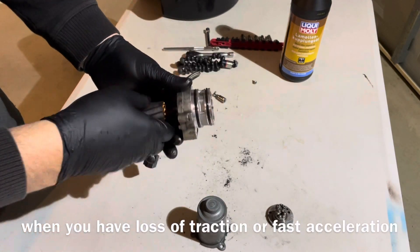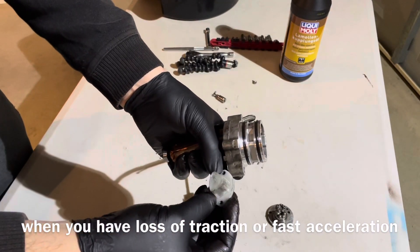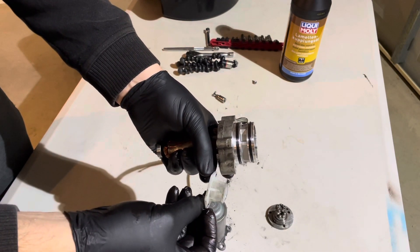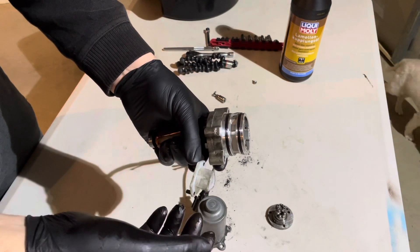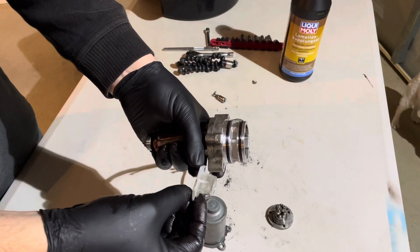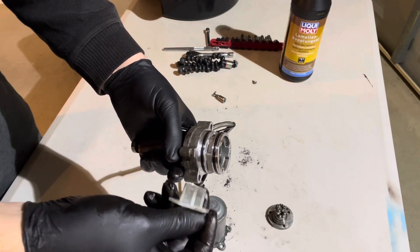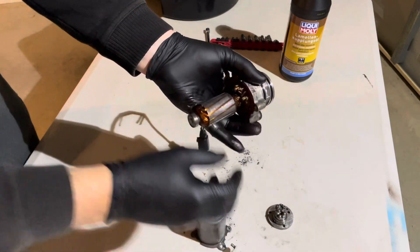...the way the filtration is — this is the little screen filter on the Gen 5 Haldex that replaced the large paper filter on the Gen 4. This has a small surface area, so it's easier to block up, but it also lets larger particles through compared to the Gen 4 Haldex. I think that puts more strain on the pump and makes it easier to starve the pump, wearing it out faster.